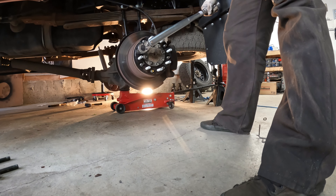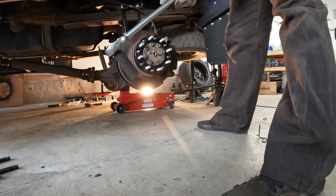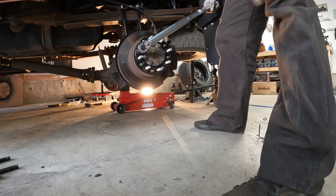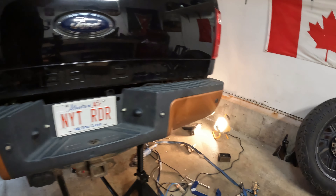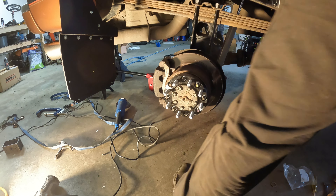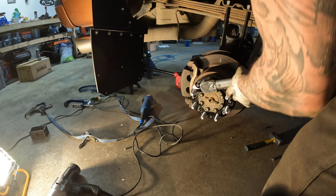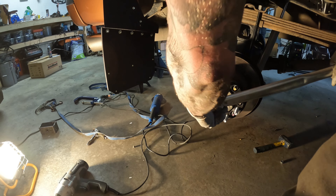Let's torque-check one of these wheel adapter nuts. I set them at 165-170 — I think I went 170; factory is 165. We'll go to 160 first — if it doesn't budge we'll try 165, and if it doesn't budge we'll leave it. We'll do one per side. I've got the parking brake on so this should work. Set to 160... okay, I had a torque to 170, let's just go 165 which is factory torque. Push nice and slow... we are good.